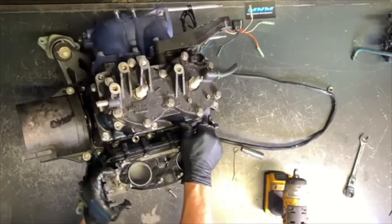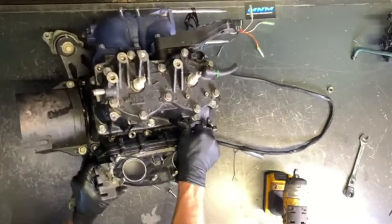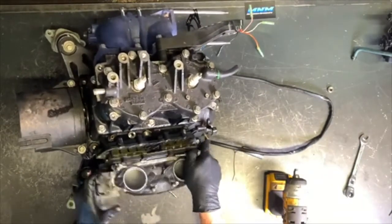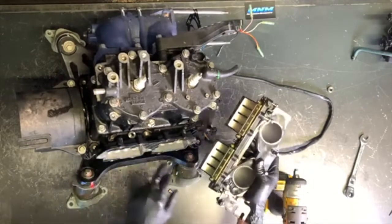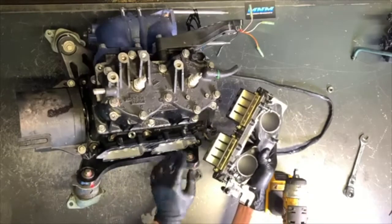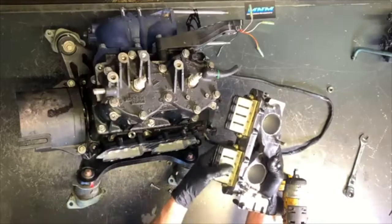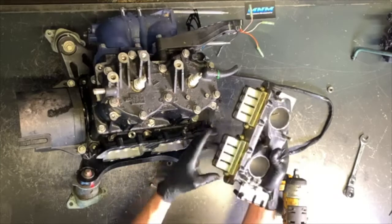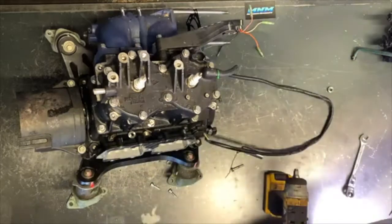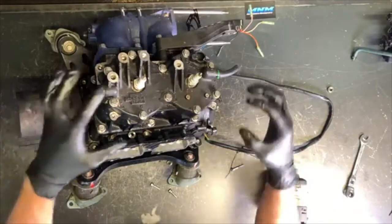Working this off — this might have had a little bit of liquid gasket on it, which seals it up really nicely. Just pry that off and there are your reed valves. You can see where the gasket stayed — going back together, this needs to be completely cleaned off on both sides. To remove these reeds, you've got Phillips screws on either side. You do want to replace these petals and inspect them periodically to make sure you've got good intake flow.